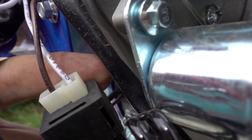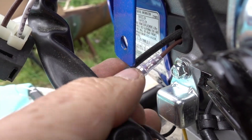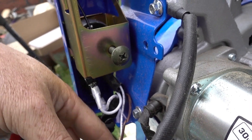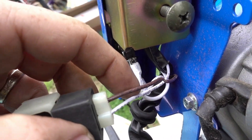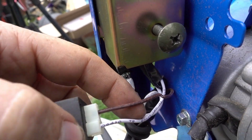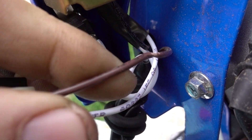See how well you can see this — here's the two wires coming out. This is the second one that we added. This wire right here goes to here — you can see it's brown. Here is the factory — I don't know if it's a rectifier or what — but basically it changes it from AC current to DC. And this white wire should go back to the battery to charge. I noticed that was crushed pretty good, so it's kind of good that we're doing this anyway.